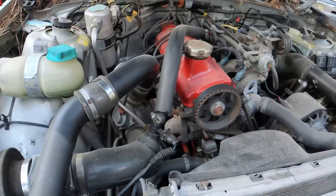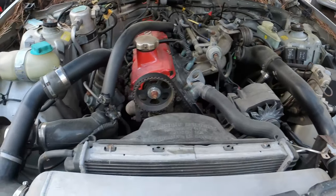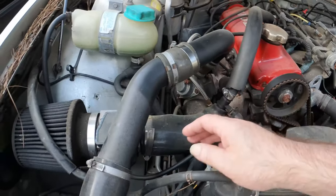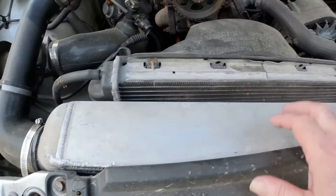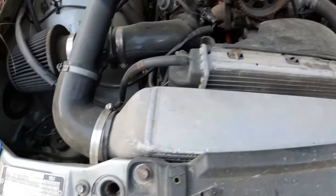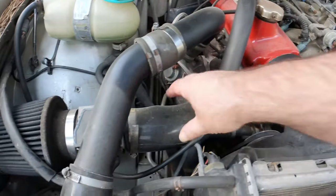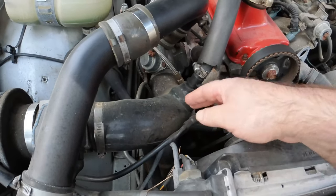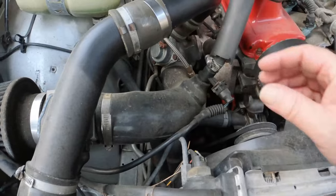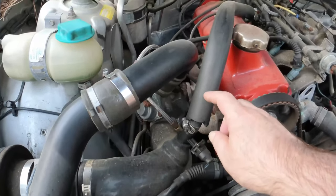This is a stock, pretty much stock basic 940. There are a couple upgrades here and a couple downgrades — even more downgrades for this unit. Because it's stock boost, it's ridiculous to have this intercooler on it. However, there are some upgrades like this harder plastic pipe, because these cars like to suck in when you turn the boost up and choke for air. This is the crankcase ventilation hose right here.